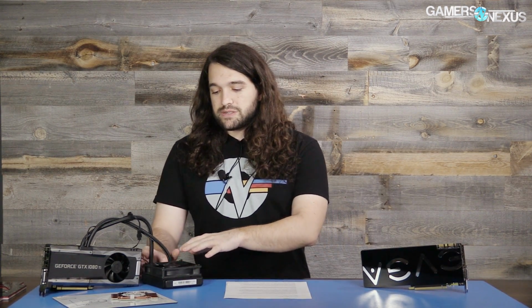That's not really something that EVGA has control over. There's a thermocouple stuck into the pump block, and it's coated in a ton of thermal paste, and that is what tells us the liquid temperature. EVGA has this fan slaving to that temperature, which tends to be something like 26 to 32 Celsius or thereabouts. Doesn't really go higher than that. And because liquid temperature almost never goes higher than that, the fan is following a parameter that doesn't make a lot of sense to follow.